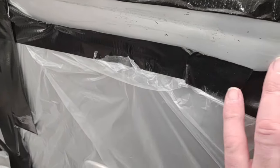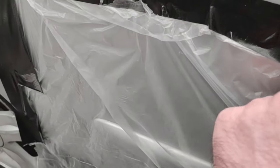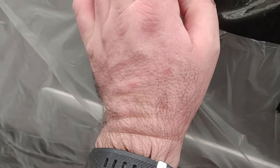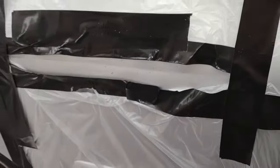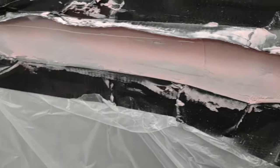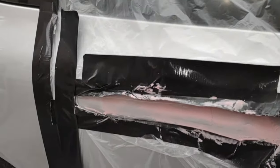I've pulled that out as far as I possibly can. What I'm going to do is lightly sand those tiny parts where the scratch is, then put a tiny bit of filler just over that and hopefully blend it in. I don't want to go over too much area because I don't want to do a full spray job. I've sanded it and filled around that scratch. All I've got to do is let that dry out now, give it a sand, then prime it and put some colour on.